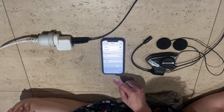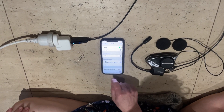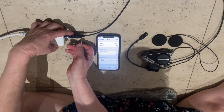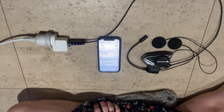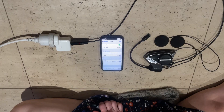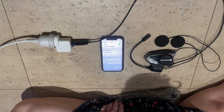In your settings Wi-Fi, I can see my 5GHz network but I don't want that — I want the 2.4GHz. My phone is already connected to it, but now I want the Wi-Fi adapter to connect to it too. It's not flashing so it's not searching, so I'm going to do a reset by pressing that pinhole. It goes purple, does a reset, and we wait for it to come back on. There it appears — the Sena Wi-Fi adapter.